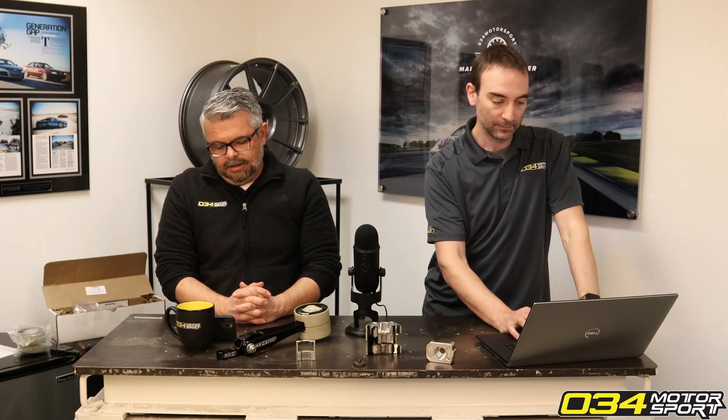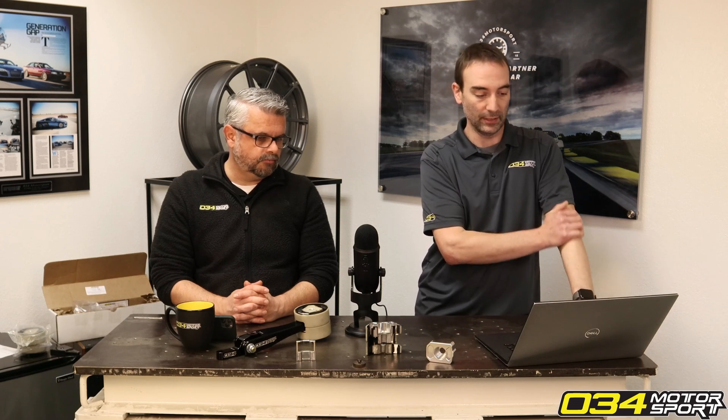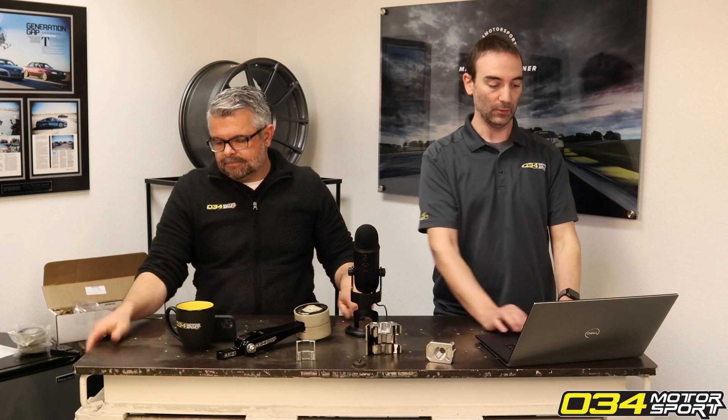Forcing a certain pressure of air inside a motor is not what creates horsepower and torque. It's also very dependent on what fuel you're running. E40 will do a lot better on a higher pulley ratio than 91, 93, or even 100. If you're running 91 or 93, I'd always recommend a 179 mil lower — you're going to have a nicely optimized setup for that fuel. If you can go to E40, a 190 mil lower with our upper pulley works really well. The amount of air — which is the boost — and the amount of fuel are both factors.